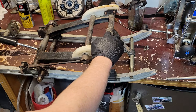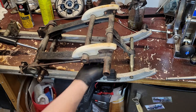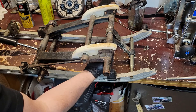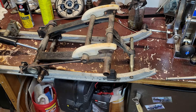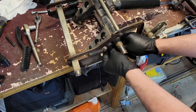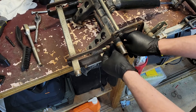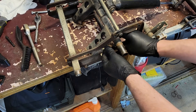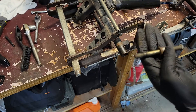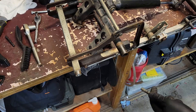The next thing I want to do is drill and tap, or weld on some nuts for some grease zerks. I have to figure out where I have the best access when it's on the snowmobile. Maybe one in the middle is probably okay, and I'll do the same on the other side. While I'm here I may as well back these adjuster bolts out and clean them up — nicer to put those in with a little anti-seize. I'll take them all the way out, clean them up, and put them in that rust bath. I might hold off on the grease zerks until I figure out the best placement — maybe do that in the next video.